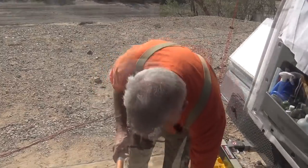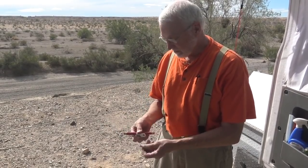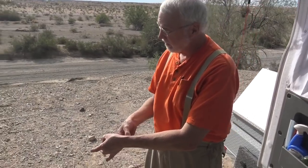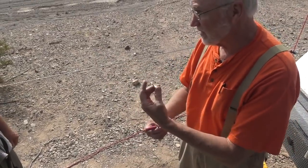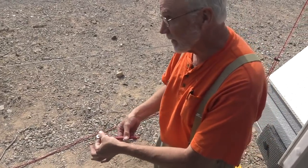If you put it in something where you get a real good crimp, which this three-point crimper is going to do, it fills all the air void, makes everything conductive, and makes sure it's never corroded. When you've got wire this thick, you want to make sure your lugs are oriented right. These lugs are going to orient a certain way because they're going to go up against the same thing. Thinner wire doesn't matter, but this thick wire doesn't like to twist.